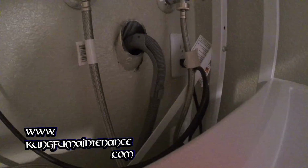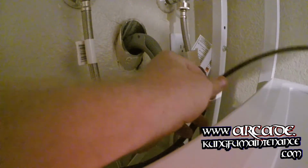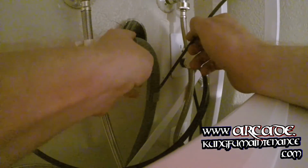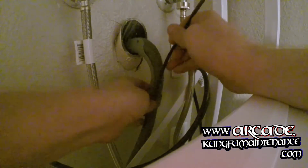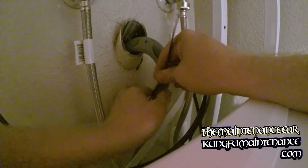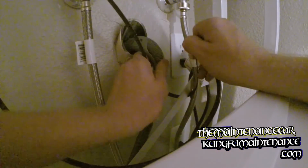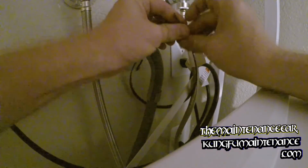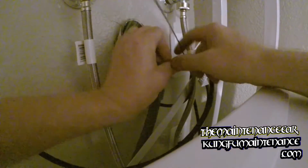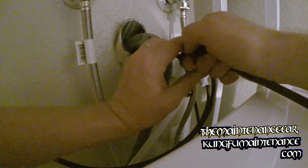Alright. So I had one of these drain lines push its way out once, and ever since then I've just been anchoring these in, either wedging it underneath something or cable tying it in, because it created a huge flood. It's amazing how much water the washing machine actually does put out, and I just don't want to have to clean all that up again. So ever since then I've been anchoring these in, and that way there's no surprises later on.